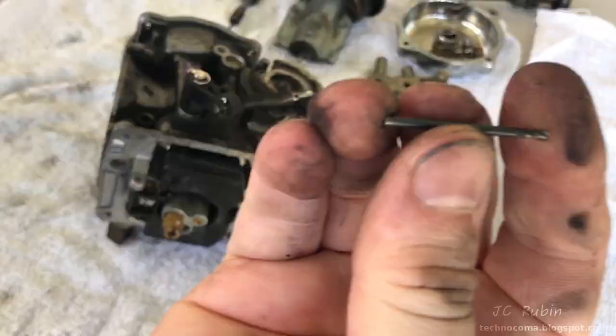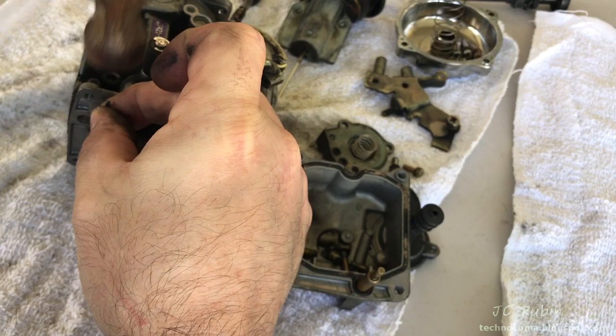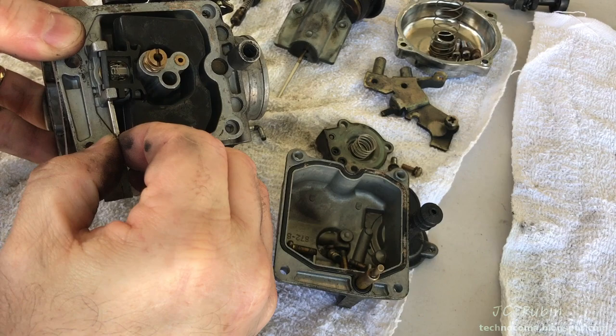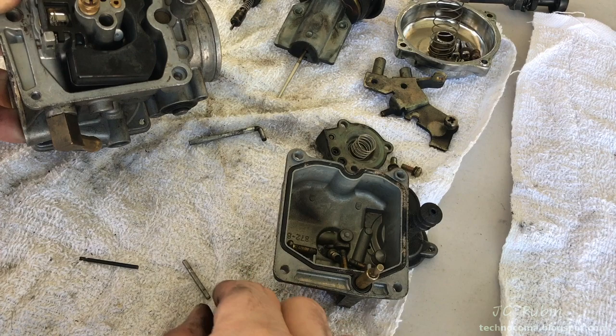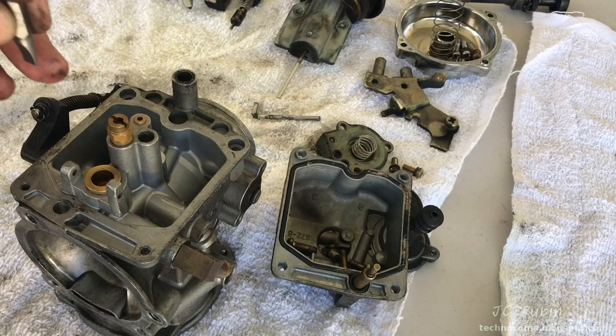More evidence of backfiring is in the enrichment circuit as well — here's a quick look inside the enrichment port. I have a drill bit with a smaller diameter than the float pin which I'm going to use just to get this started. The pin is a bit gnarly so it was hard to get started; I'm going to have to fix this pin before it goes back in. But it's out now.